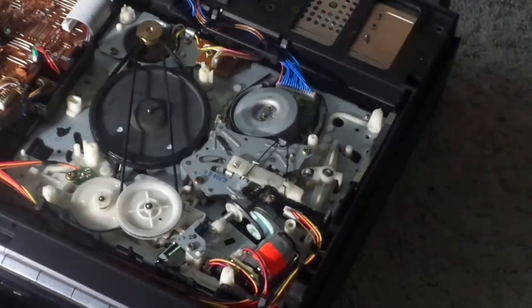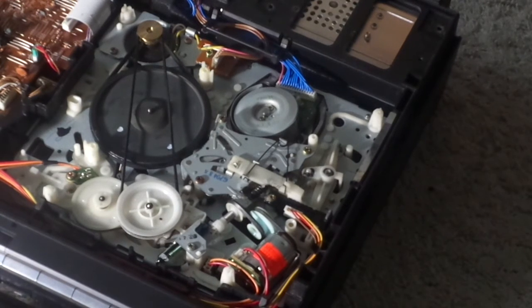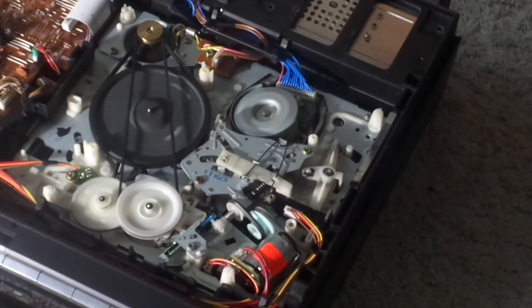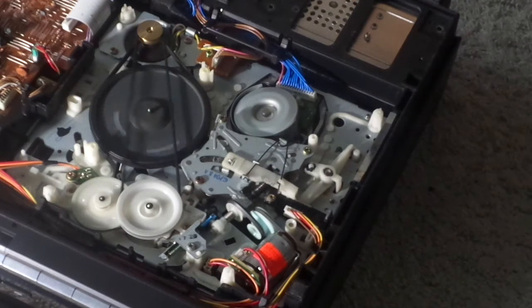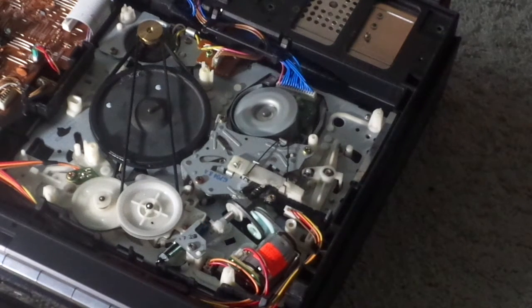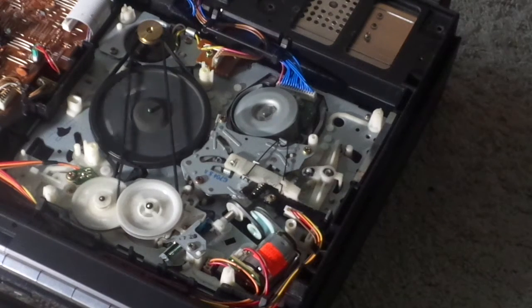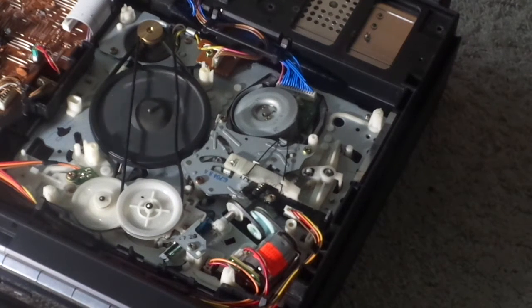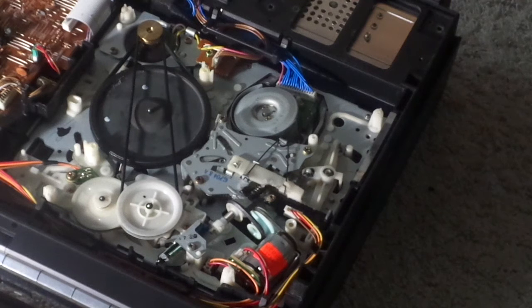So I'm going to use a certain tape. I'm going to turn it on — power on before I do anything, because this is an older VCR. And as you can see, this belt is kind of worn out, but it's still able to be used to play cassettes. This one never ate my tape, so I'm going to press stop. But when I tested it at Savers, it won't fast forward. Watch this — see, it barely even turns. Now let me rewind. It doesn't turn, and it just goes into stop mode.